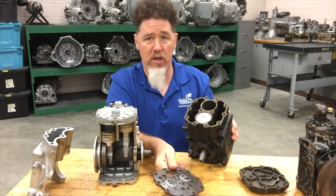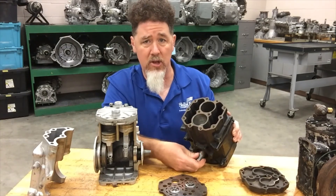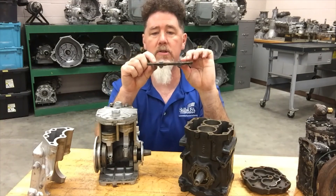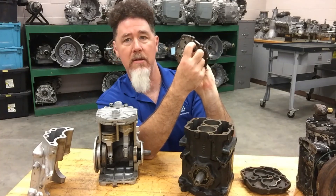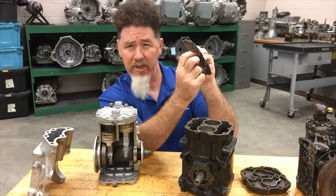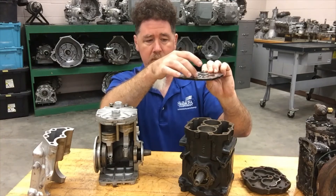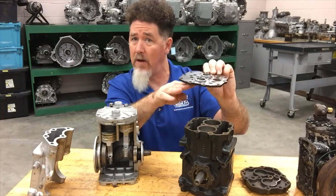I can tip this one up and you can see the two cylinders. I can turn the crankshaft — one piston is out but the other is still able to move up and down. With the reed valve system, you have a pretty heavy thick plate of metal in the very center, and then on the bottom a very thin piece of metal. As the piston goes down and creates a vacuum, it's going to open that thin piece of metal and allow the air in, and seal the heavier exhaust valve on top.